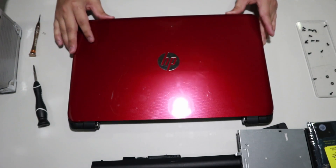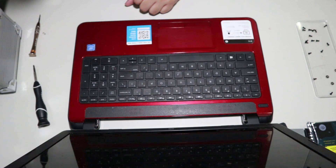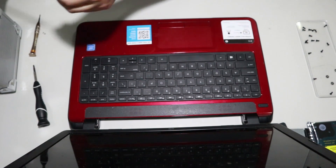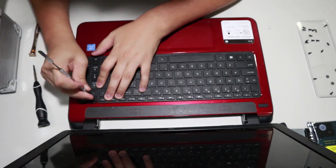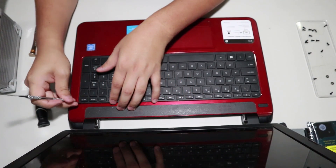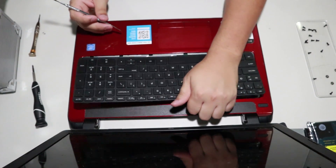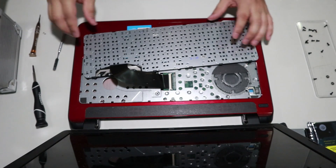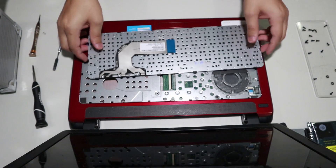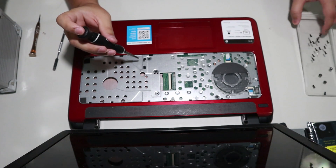The next step is to turn the computer around and remove the keyboard. The keyboard is only held on by clips and one screw in the back, but of course you've already removed that screw. Find that same flat device you used to pry open the RAM cover and slowly take off one corner. Once you pry up one corner, you should be able to pull up on it slowly with your fingers and it should come right off. Once you have pried the keyboard up, be very careful — there is a flex cable attached to the motherboard. Make sure you lift up the little black tab on that connector and just remove the flex cable.